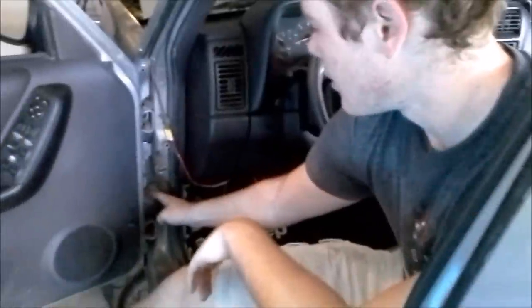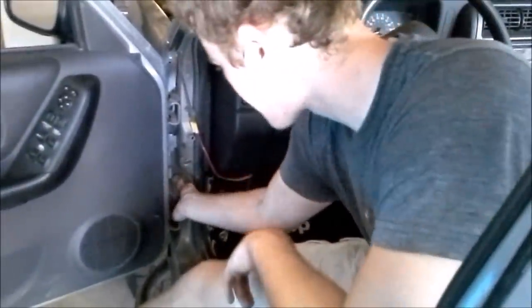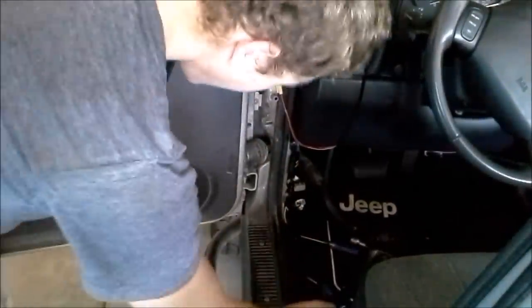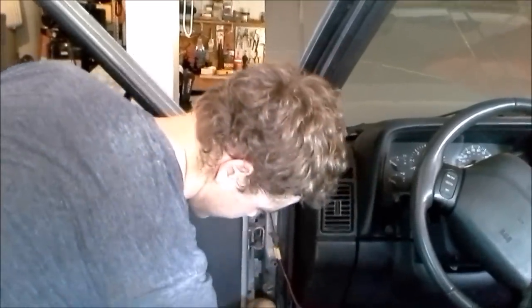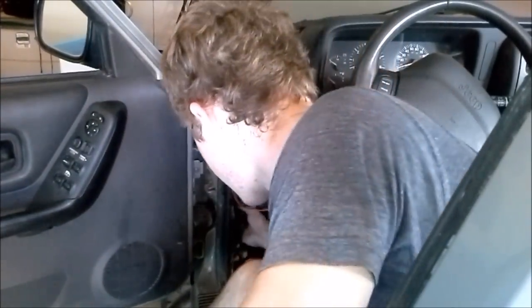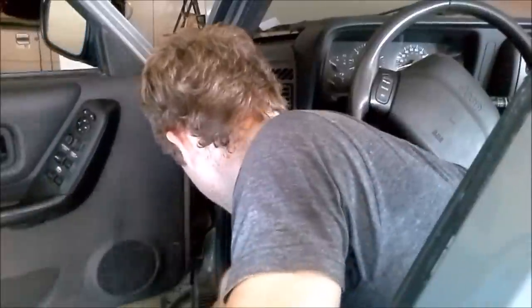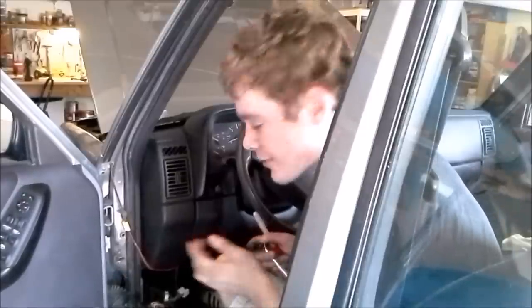Now that we've got them undone we have to be able to pull them through the door, so I'm going to grab this rubber grommet and pull off this hose. Now that we have the rubber hose off we're going to be able to pull all of our wires through this hole. There's also a rubber grommet on the back that you're going to have to squeeze through — you can push that through either with a screwdriver or with your fingers — so we're able to pull all the wires out through the frame.